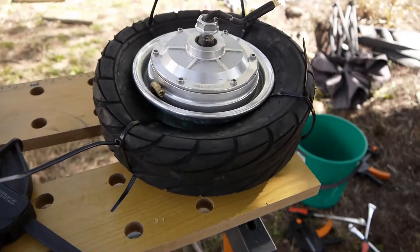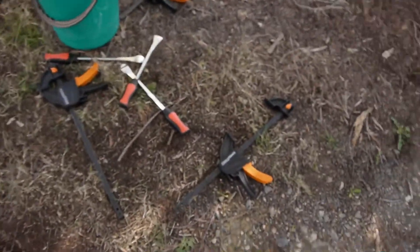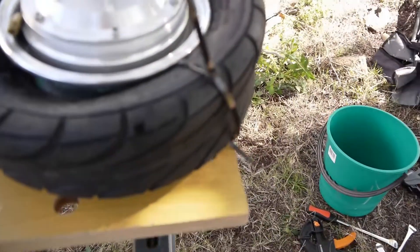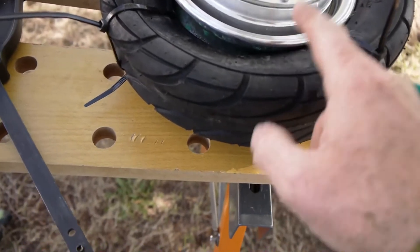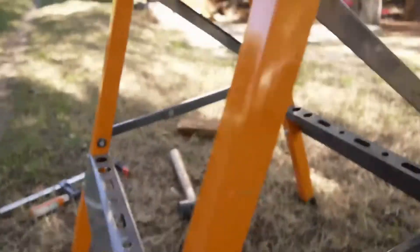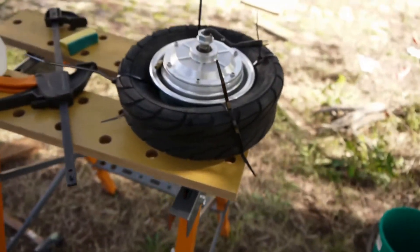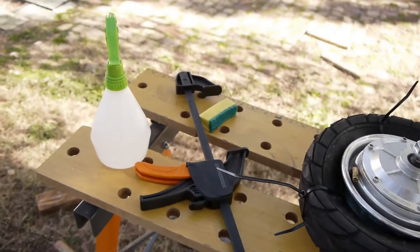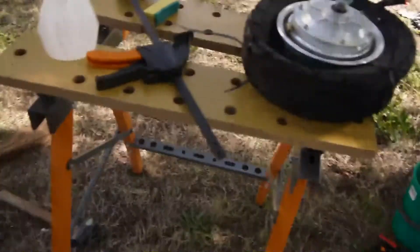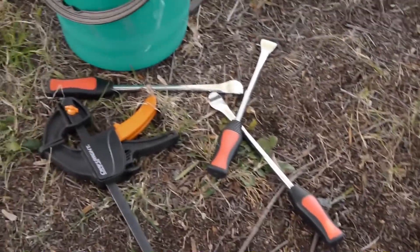I finally got the tyre on, which took a bit of intimidation. I used a number of these clamps, which you can see lying around on the ground, and good old-fashioned cable ties — I put four cable ties on. It's easy to squeeze that side of the tyre onto this side of the rim, and you work in this direction because that way you can keep the disc flat on the workbench. I gradually worked it around and used a little bit of soapy water on a sponge, and the judicious use of levers to lever it around. The cable ties prevented it from popping off.